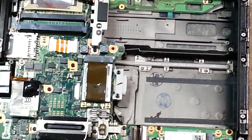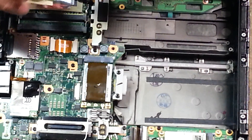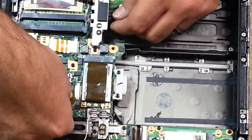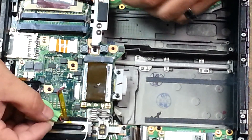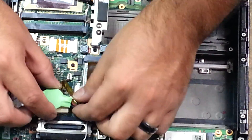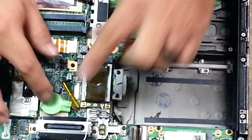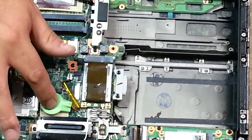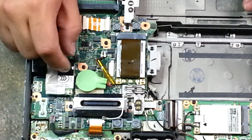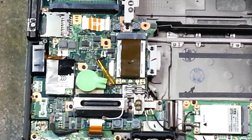Don't want to break any of these — that'll just ruin your board. So to reinstall your new CMOS battery, I like to connect mine and put it back into its connector first. Then just simply follow the outline and drop that in there. Just gently put pressure on the middle, and the double-sided tape will adhere to it.